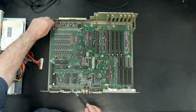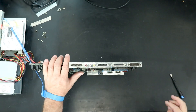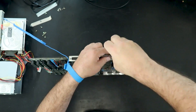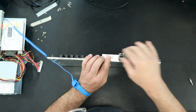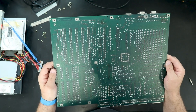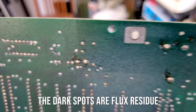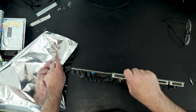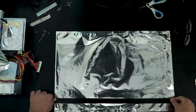Time to pull out the motherboard for my first good look. It's an earlier version 4.4 board. To get a good look at the bottom, I first need to get the RF shield off too — it's held on by the port connector screws, and the only way to get it off is to bend it away on one side. The bottom of the board doesn't look too bad; I can see a little bit of flux residue and it looks like one of these ports has been replaced. The important thing is I don't see any sign of battery acid leaking through to this side. This board is so huge I actually had to cut down two ESD bags and tape them together to make one big enough to fit it in.